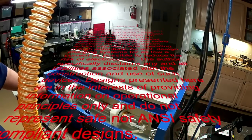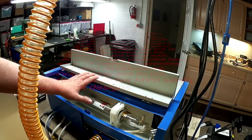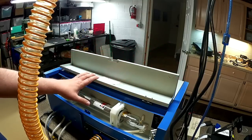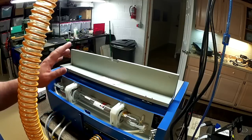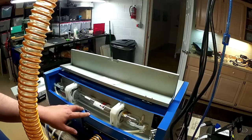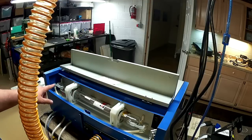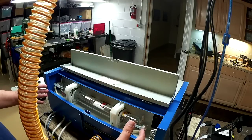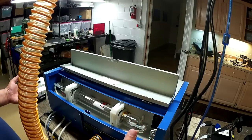For example, number one, it needs to be unplugged. Number two, I would suggest leaving it sit overnight to make sure everything is discharged properly. And even then, it does not mean that the high voltage is discharged, so you should address this properly. I've worked with high voltage quite a bit of my life, so I understand a little bit about the dynamics and how to deal with it. One of the things you want to do is number one, keep your left hand away from there. Number two, you do not want to have your hands in situations where you can create a circuit which runs through your hands, because that's going to run through your heart and stop your heart.